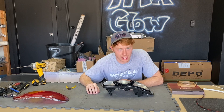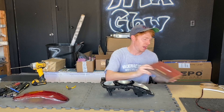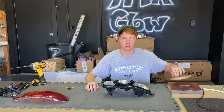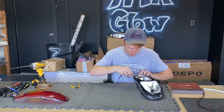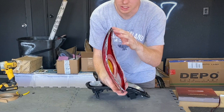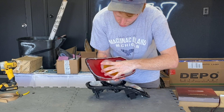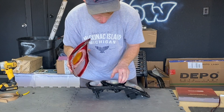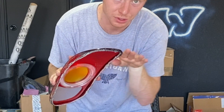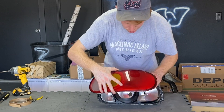After you've done your modifications it is time to reseal the lights. Get the retro rubber and fill the trough back up with butyl. When putting the lens on, look out for a couple of things: this circle here has to sit right inside this trough, and this part is angled out so you have to get it underneath these lips to seal up. It's a little tricky.